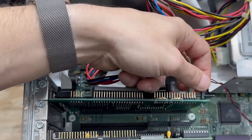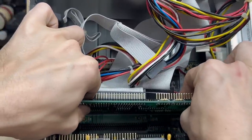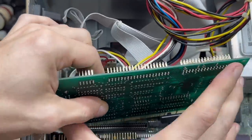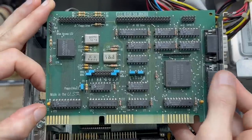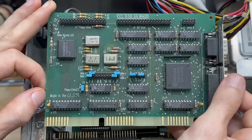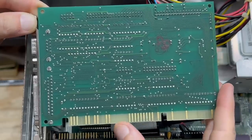Let's get rid of that hard drive LED — that's pretty stuck in there, probably means corrosion. Luckily the edge connector survived. Got a pretty basic IDE I/O card, Samsung chipset, made in USA. The backside looks pretty good and this edge connector should clean up just fine.